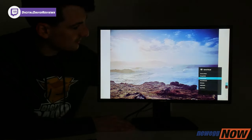specific panel. Now, since this is a TN panel, this is really geared towards gamers. So if you want that performance, this is the panel you're going to want to check out. You want a TN panel if you want those really fast response rates, refresh times, that sort of thing. Typically TN's gonna be the way to go. Nothing wrong with VA or IPS as well. They definitely can handle that too. But stereotypically, a TN panel is gonna be for gamers.